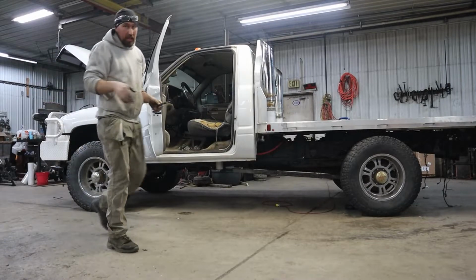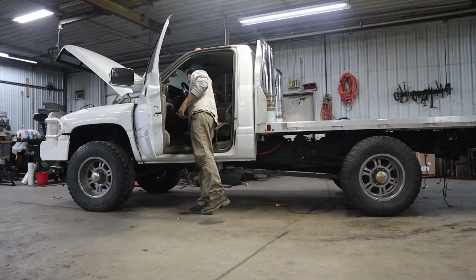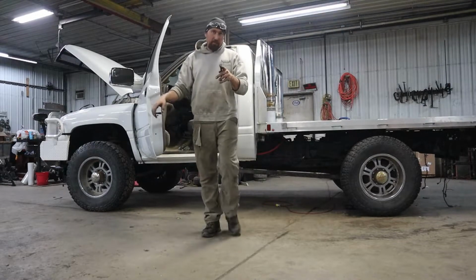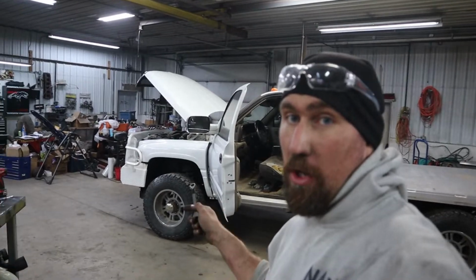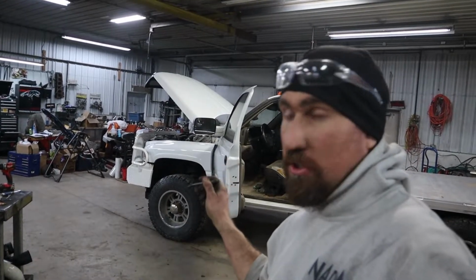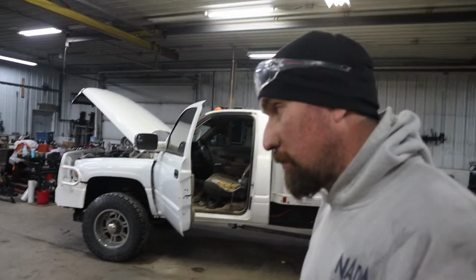I don't know what's going on with that. That's not good. That was an odd one. I've never had that happen. I think what's happened, I think it's set for long enough. I think the contacts on the starter are sticking. So I think I'll have to pull that starter off now. Just another thing, you know, but dealing with old trucks is what it is.